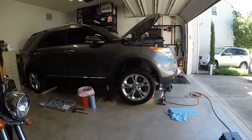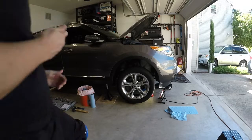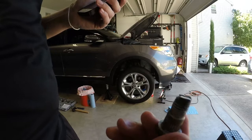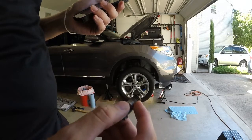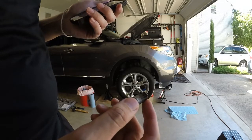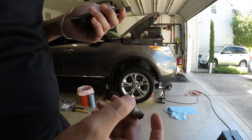The biggest thing I could say about this is everything is patience, and make sure no matter what, whenever you finish a project, inspect your studs on your wheel wells. I don't know if you can see that, but that's obviously the piece that snapped off. It did show obvious wear, and I'll show you again once we get in there, but you could see the thickness throughout was not even, and I saw it on one. There were obviously two others I did not notice, so I call that out.